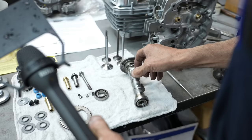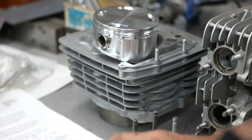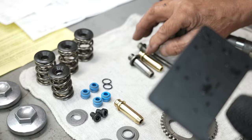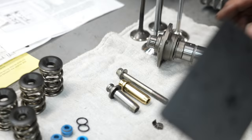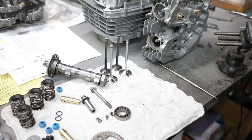The reason why we're putting shorter guides — these are 80 millimeters, 2 millimeters shorter, which is 80 thousandths. From here up, they're shorter. Because this cam is going to depress the valve spring down closer, and it mashes the valve seal and hits if you don't have shorter guides in there. So that's why we have to do that.